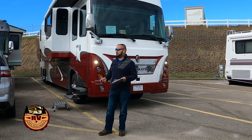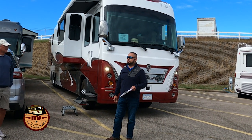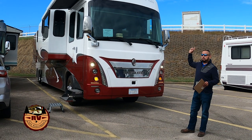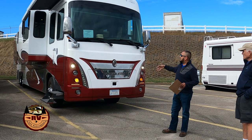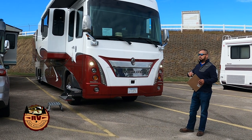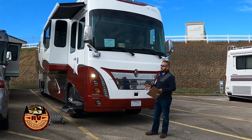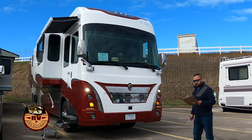So if you have any questions, feel free to interrupt at any time, and we'll address your question. All right? So what I like to do first is turn headlights on, turn my four-ways on. That way you can get a good look and you'll get a good idea if your turn signals are working, your headlights are working, all of your clearance lights, front, back, down the side. That way you can make a note if you have something that's out, if you have something critical that's out, like a turn signal, you can address it before you even get on the road. It's a good safety practice to do that before I get on the road with any coach that I have.